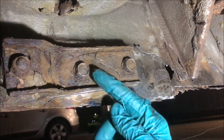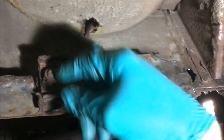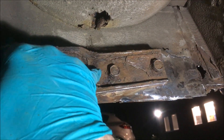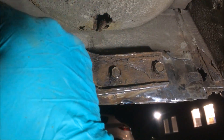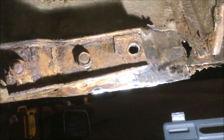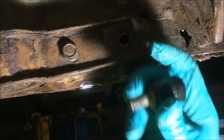I'm going to get my impact gun and see if I can shift these. I don't want to undo them all the way because obviously they're holding the axle in, which is what's holding the car up — so if I undid them the whole lot would shift forward and fall off the axle stands, which would be bad. I've lubed them from the other side with WD-40, I'll hammer on a six-sided socket and use the impact gun one at a time so when one is undone I put the other back in. That worked better than expected — got both of them out.